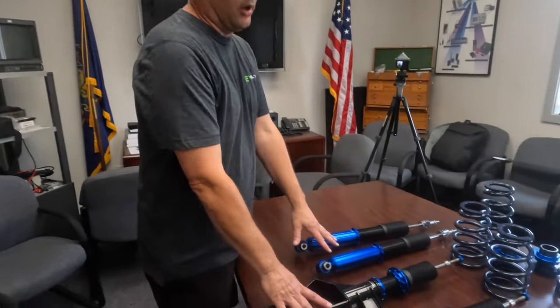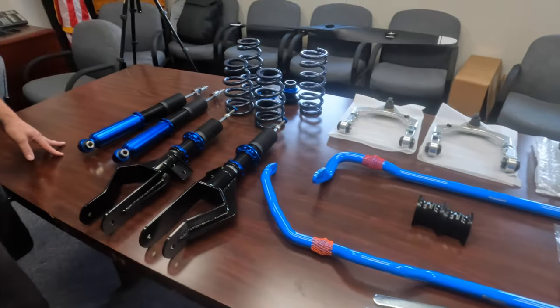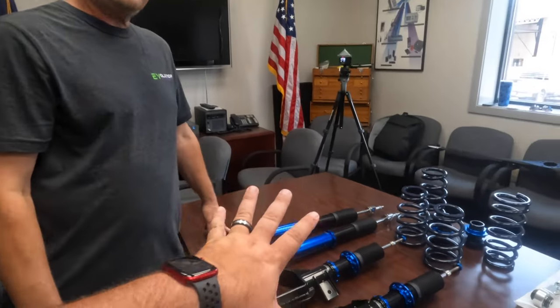The only issue right now is there's a back order on the luxury system. The rest of the stuff's pretty readily available. Most of the Teslas, the 3s and the Ys, I've heard a lot of stories of them coming out of the factory with the alignment off, right at 0 miles. The camber is not adjustable. There's very minor adjustments you can make, but once you put this on, this car will be fully adjustable front and back.